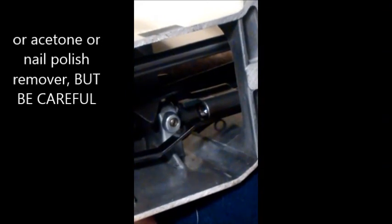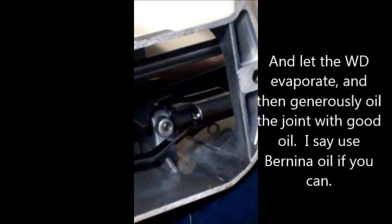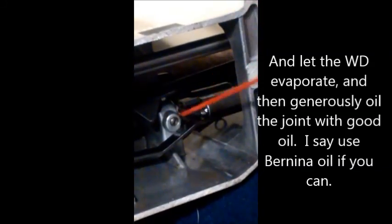How do you do that? In my case I used a product called gun wash out of my paint room. Be very careful with anything that's flammable — always use a small amount. I took gun wash on a Q-tip and put it in everywhere around those joints and just started to free them up. I also used WD-40, which does not belong in a sewing machine unless you're using it to unfreeze or unseize two pieces — which was very helpful in this case. I was able to get right in and shoot WD-40, and that managed to free up that little piece. Now it works like a charm. I hope it helps somebody — thanks for watching, bye bye.